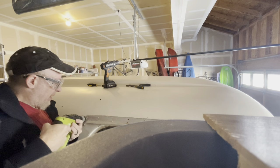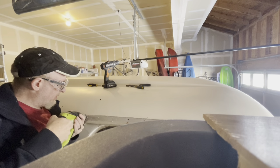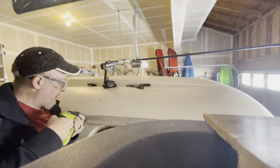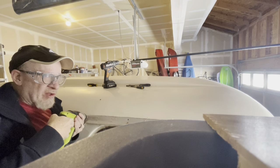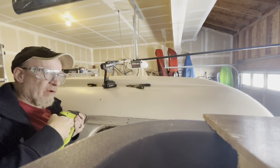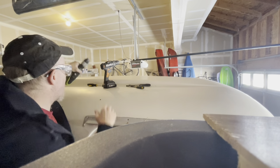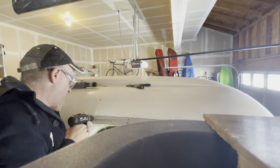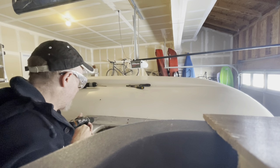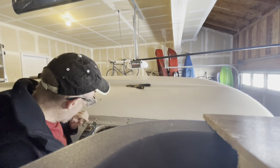Hopefully you can see it, but I just go right at the corner or the edge. It doesn't have to be down the middle, and go real slow on your drill bit. You need a sharp bit, a small bit — get a little hole started and then go back with a bigger drill. Pretty good. There we go. You can hear that snap.